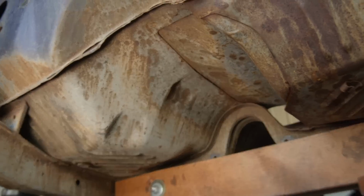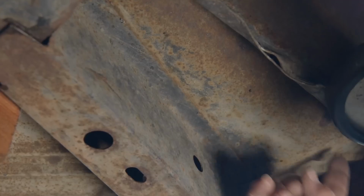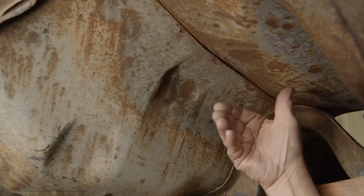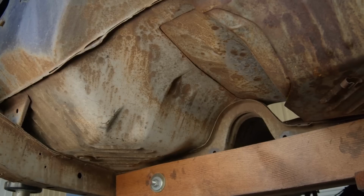The secondary damages are the things that happen as a result of that trauma. It could be the engine and transmission, for example, in a hit like that. They're suspended in rubber. It's a rubber motor mount. It's a rubber transmission mount. Rubber has flexibility. The car stopped suddenly, but that engine kept moving. So it would have damage to the right frame rail in addition to the impact. But then it would come back because it's made out of rubber and bounced off the left frame rail. And it could have hit the center tunnel with the transmission.